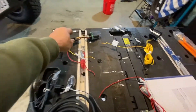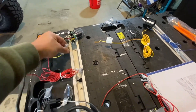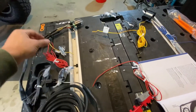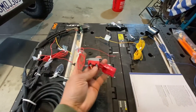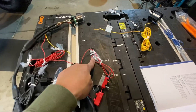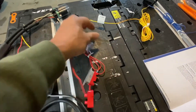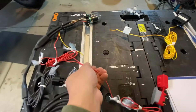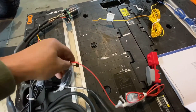Off the relay here, you've got your accessory going to your switch, and then this goes to your battery source. All coming off of this red wire right here will be another little 15-amp fuse. This will go right to your battery terminal, which comes with a little round connector that goes into your battery. You can mount this inside your firewall somewhere, anywhere, and then this will come right into here.